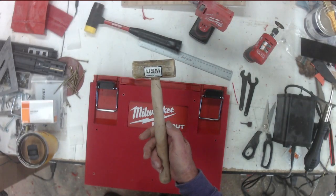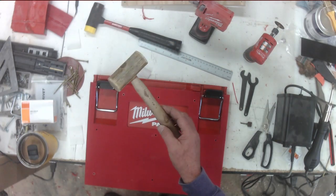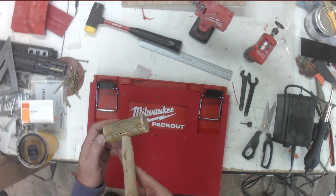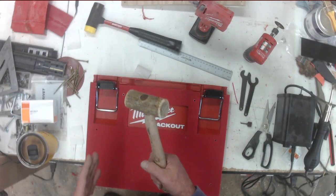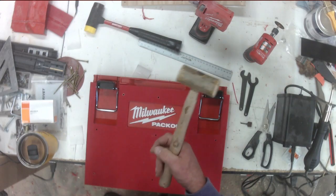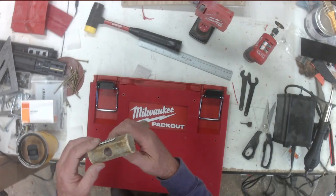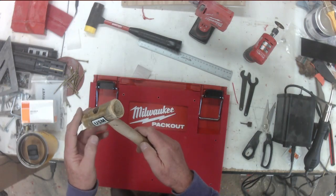This is also another very common mallet used in the bike shop, and they call it a donkey hammer because I guess apparently it's a leather mallet. But sometimes they use donkey leather to make these out of. And again, just kind of a soft blow. You know, if you're trying to remove a stem that has a quill bolt in it, that's how you remove it, as you unscrew it. Usually see those with rawhide, yeah. But yeah, like I said, that's just what people in the bike industry call it. Is a donkey mallet.